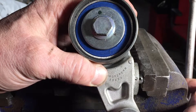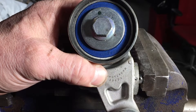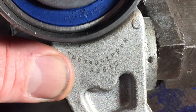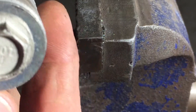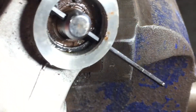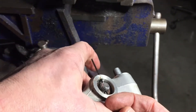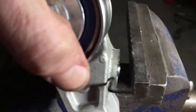I'm using a two-millimeter Allen wrench and bringing the vise in really slow. You definitely have to bring it in slow because you're compressing that hydraulic cylinder inside and you don't want to damage anything internal. Sometimes you have to loosen it up a bit. I'm going to put it in the vise again and just bring it back a little bit.